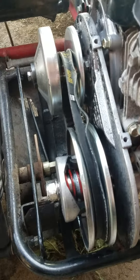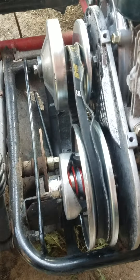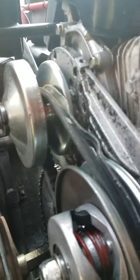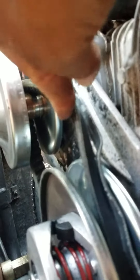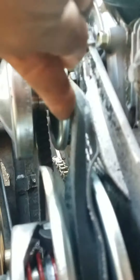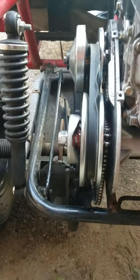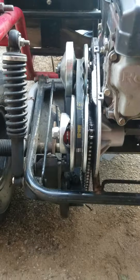Look what the converter did to my belts after maybe about an hour of playing with it. I'm not sure exactly what happened. Recording so somebody can see. See the brass bushing how it is. I know that if the drive got stuck open or what, but look at the belt.